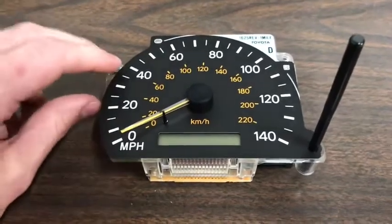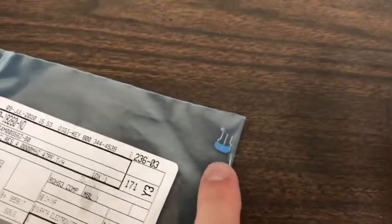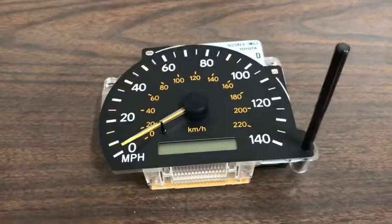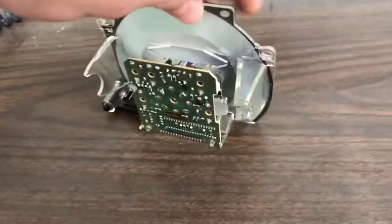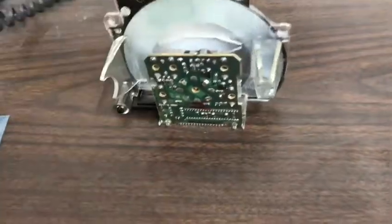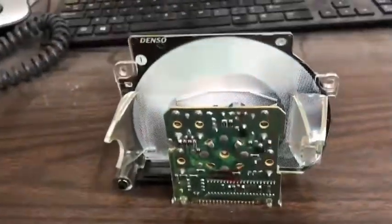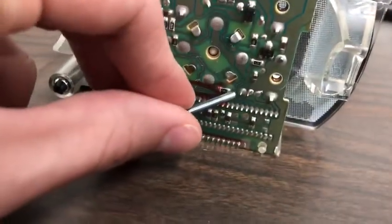To keep that from happening, I found a replacement part and will provide a link below the video. It's a ceramic resonator replacement you can get online. I'll show you how to remove the old piece and solder the new one back into place. Since it's a tight area and I didn't want to take the whole thing apart, you can fix the issue by soldering that piece on the back in those three places right there.